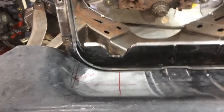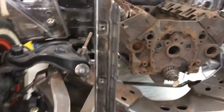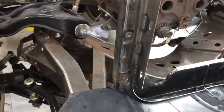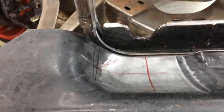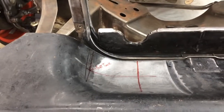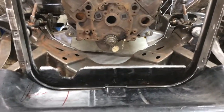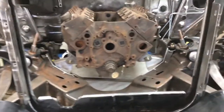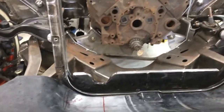Actually not two drain holes — I need to recreate one for the petcock drain, and down on this side somewhere where the overflow comes out of the radiator, that's got to have a hole down through that pan as well. I tried laying this out with measurements and dimensions, but because of the curves and all that stuff, it's tenuous at best — really hard to determine if that's accurate. So what I decided to do was put it back on the chassis one more time and hang the radiator in there so I can measure right off the actual radiator itself. Sometimes you overthink this stuff and it leads you right into a trap. So this is what we're up to today, amongst other things.